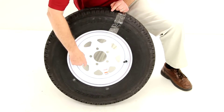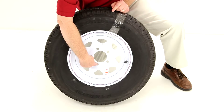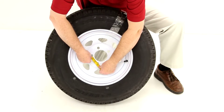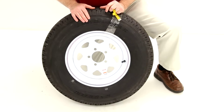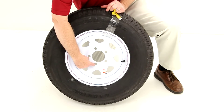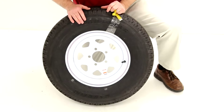The other way is to pick one lug hole and measure from the center of it to the center of the lug hole right next to it. That measurement will be two and five-eighths inches. You can then go to the product page for this part number — at the bottom there's a chart showing that when this measurement is two and five-eighths inches, the bolt pattern is a five on four-and-a-half inch bolt pattern.